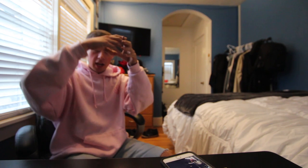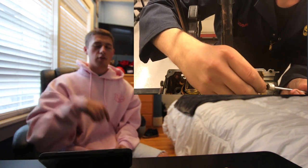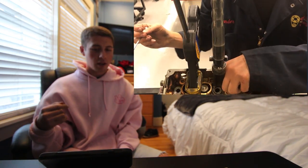Now let me explain the spring removal tool before the video plays. It's not really a machine but what it does is depress the spring — I'm actuating it with my foot, pushing down a rod that presses on the outside of the spring. When the spring compresses I can take out these little things called keepers. There are two of them per valve. Once the keepers come out, the spring can come up with the retainer on it and then you remove that.